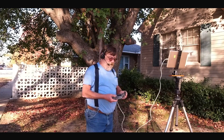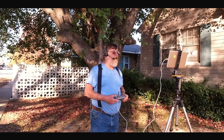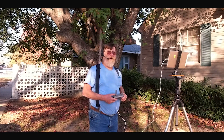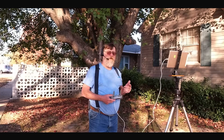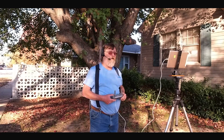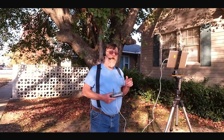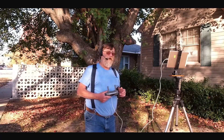Where I'm at, I have a 200-foot ceiling, so my return-to-home altitude is set at 98.4 feet — basically 30 meters, roughly 100 feet. On my first run, I'm going to take the drone out probably 500–600 feet away, be at about 60 feet, hit return to home, and the drone should climb to basically 100 feet and return home. Then I'm going to do another test where I fly out the same range — 500–600 feet — at 150 feet, staying well below my 200-foot ceiling, and hit return to home to see what the drone does.